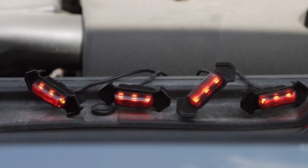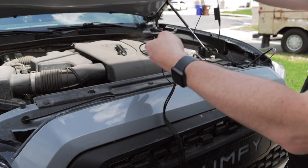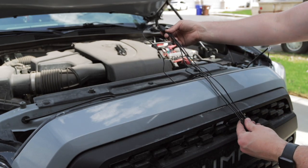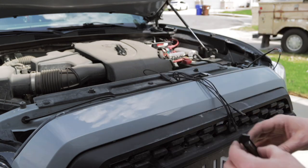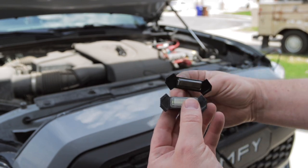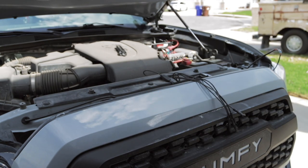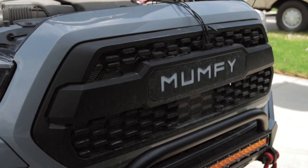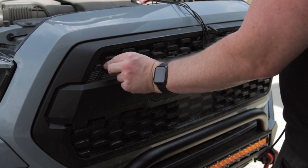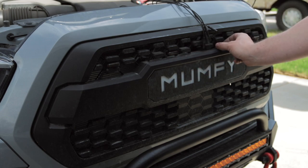We'll see how long they last and hold up, but let's get them in the grill now. One of the nice things about this wire harness is that it does give you a lot of length, and for each of the grill lights you actually have quite a bit of length so you can run them to each of your locations. On some of these in the past — specifically on the end pieces of my grill — I've actually had to clip the ends just so they'll fit in the grill. You might run into that issue in certain parts. One thing I'm running into is these center ones are actually too small so they don't clip in, but the sides should secure. I'm definitely going to have to zip tie these in so they hold — they may rattle a little bit.